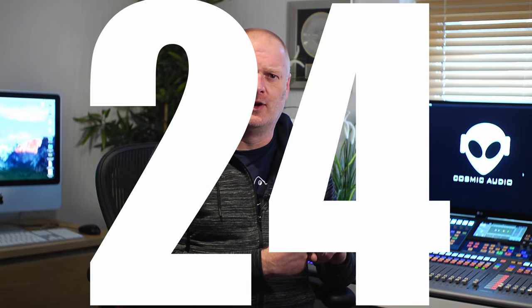Then we moved, and that Mac Pro started to get a bit long in the tooth. We looked at new Mac options, but Apple had ditched support for PCI, leaving us with two options: USB or Thunderbolt. The problem with Thunderbolt in 2016 was that you could only get an eight-channel interface. We need three times that, so once again it was back to ADAT — an eight-channel Thunderbolt interface with two eight-channel ADAT expanders. ADAT, go away, never come back.